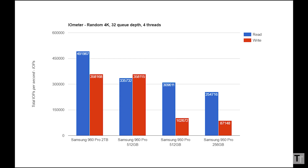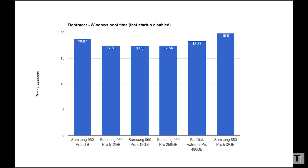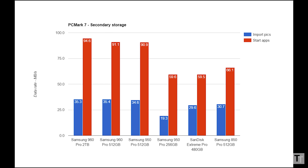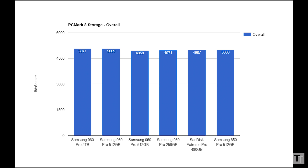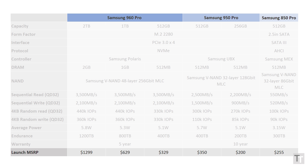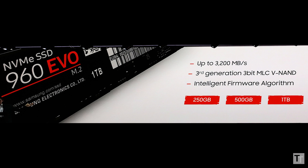How does that translate to real-world performance? Boot times and game load times are improved, but it will feel like a subtle difference if you've already got a very fast NVMe drive. A 40% jump in read speeds is decent, but it's nothing compared to the 400% increase you get moving from a SATA SSD to an NVMe drive. The first potential issue is price — while the 512GB version is actually slightly cheaper than the 512GB 950 Pro was at launch, it's still a lot of money, and without a 256GB option many buyers will no longer be able to afford a Pro drive. Thankfully Samsung is soon to release a 960 EVO, which should actually beat the 950 Pro in most scenarios and make for an ideal budget option, though it is TLC-based, so some users will still pine for a Pro drive.